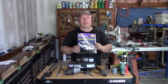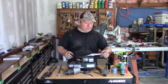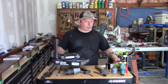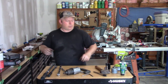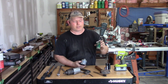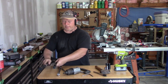I like to have a workshop manual — this is a Haynes workshop manual, that's good reference. I bought my parts this time at CarQuest, and for the premium pads and the premium rotors I spent $209, and that includes brake cleaner, which you'll also need. Some of the other things you're going to need: I use anti-seize compound pretty much on everything. This is ultra-disc brake caliper lube — use that on the calipers in a couple of different spots. Torque wrenches, one set at 25, one set at 80 foot-pounds — you'll need those.